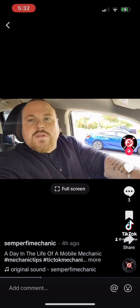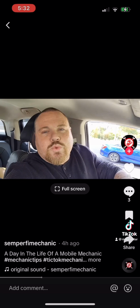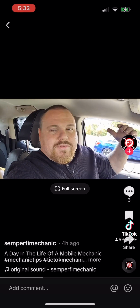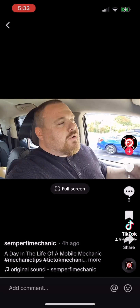All right, well, that was a quick little diagnosis. He was also headed to work. He was on a time crunch. So we just wanted to do it real fast for him. We didn't want him to have to leave and me stay here looking at his car. It's obvious, them cables, there might be corrosion all the way down that wire. We'll go ahead and get new battery cables put on there. That'll be step 1 with this. Sometimes there's 2 or 3 things wrong, especially if it sits for a while.